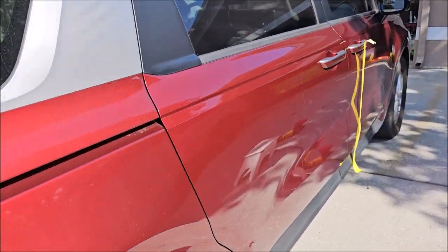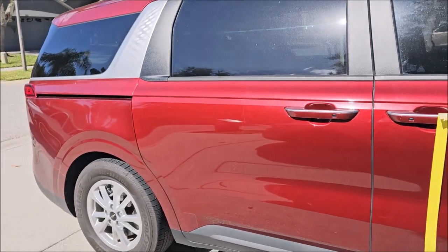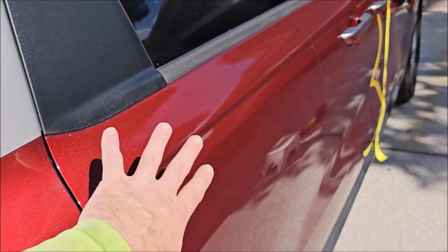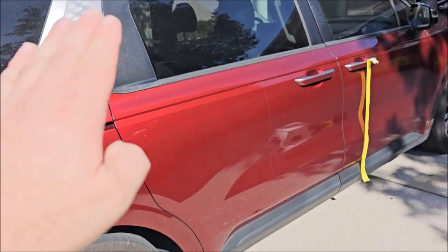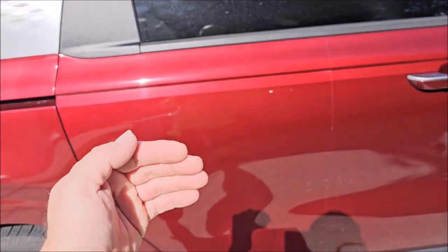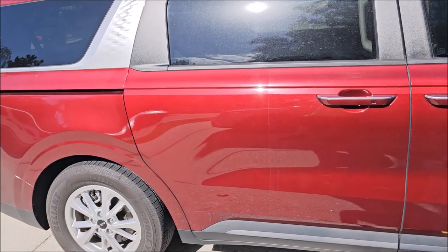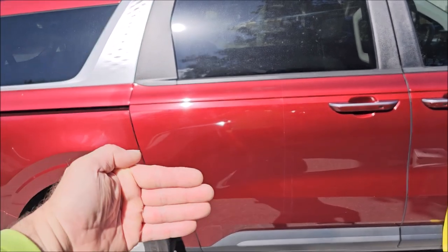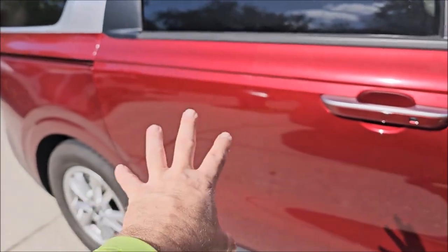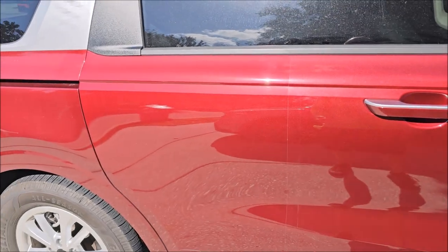All I did was a one-step — just a quick up and down, side to side, and then up and down again. I did that in direct sunlight with that polish right there. Another benefit to this polish is I don't have to prep this to receive the Fast 5 ceramic coating. You can literally go right into applying the coating right on top of this polish. So the ceramic acrylics blend in the polish locks in the scratches to fill a lot of what's there. And then the ceramic coating seals all that in. It will physically and chemically bond to that ceramic acrylics blend that's there.